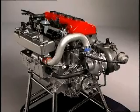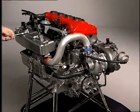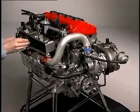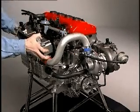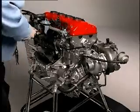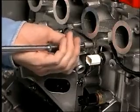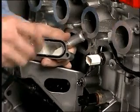The final anode is located on the cylinder head, below and slightly behind the throttle body. This anode is similar to the anode on the exhaust manifold. Remove the sub-air box on the turbo model and the airbox on the normally aspirated model. The intercooler and pipe are removed for demonstration purposes. Remove the throttle body, then remove the two bolts, stay, and the water hose joint. Once the hose joint has been removed, anode replacement is as simple as removing the screw and anode.